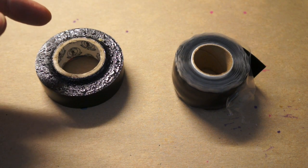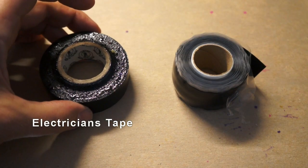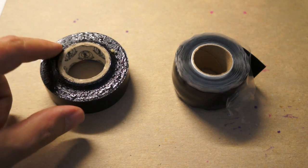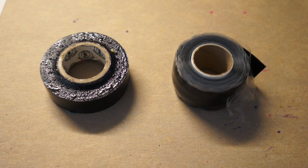This is normal electrician's tape — the same black stuff you buy that you usually use when splicing two wires together. One of the problems with it is the glue melts. You can see the glue is real sticky here, it's oozing out. It's about 90 degrees in my garage right now, and this is what happens if you use it to bind a wire or cover a hole in a hose in your car — it gets hot and the glue melts.